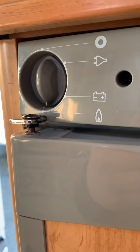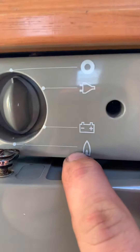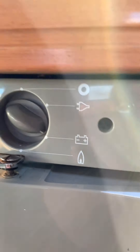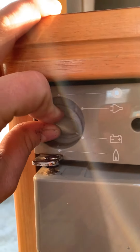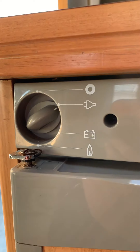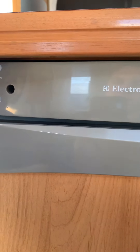I've got the fridge on gas at the moment, but I'll switch it all the way off so I can show you from scratch. So it's a three-way fridge — it works on either the hookup cable, the leisure battery, or gas. Basically if you try to use it on the leisure battery setting now with the engine not running, nothing will happen. As soon as you switch the engine on, it will start cooling the fridge down via its 12-volt element. That won't get the fridge cold on its own, especially if you've got things in it. So you need to either get the fridge cold first with a hookup cable or via the gas — perhaps the night before you go away, or at least a few hours beforehand. And then when you are driving, just remember to switch it down to the 12V setting, and when you get to where you're going, everything will still be cold.